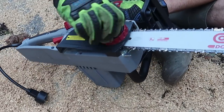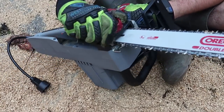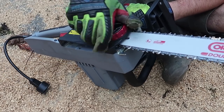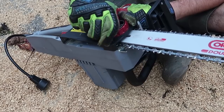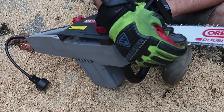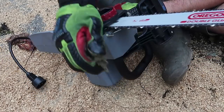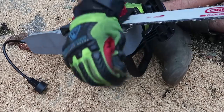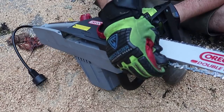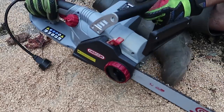Okay, then you put the lid back on and screw it back on, and adjust the blade right here. You see how it's too loose? So you can make it much tighter, but not too tight — something like that. That's good. Then tight all the way. There you go. I'm happy with that. Very interesting design.